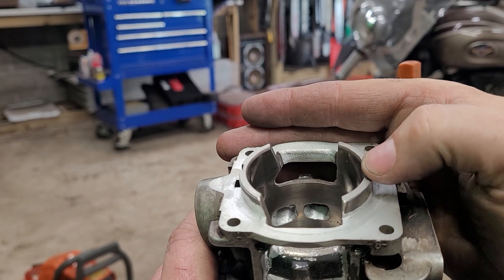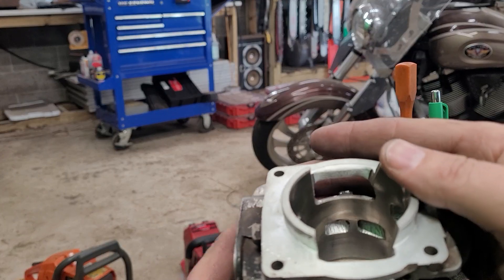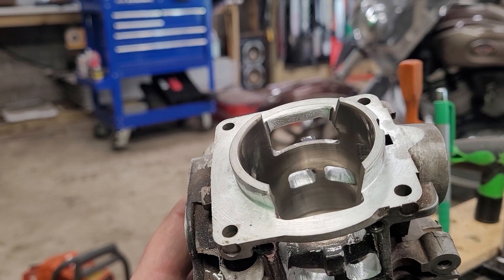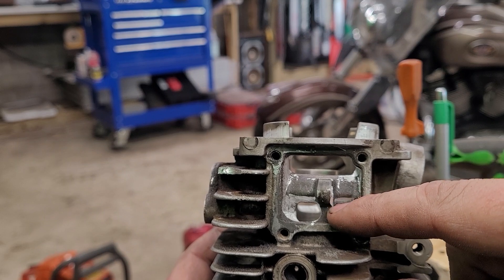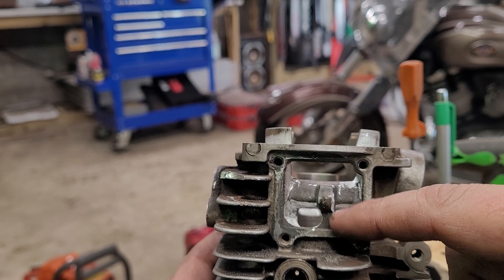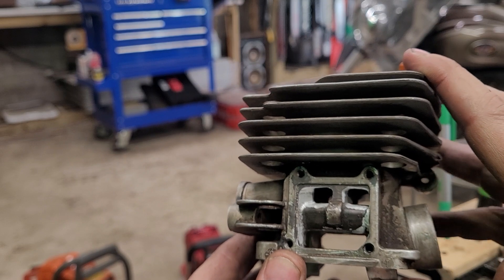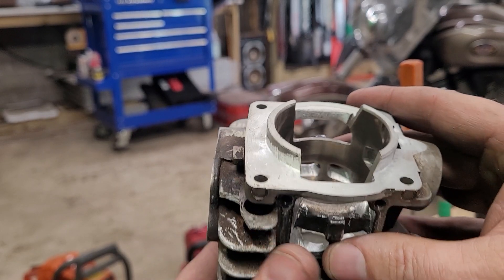I was trying hard — I really was. I got the transfers as flat as I could get them across the top using a real little tool here — really nice and flat across the top. Matt basically told me to shoot for 16 degrees of blowdown, but I got closer to 14 degrees of blowdown. So that's not ideal, but it'll probably be great — maybe I found something crazy.